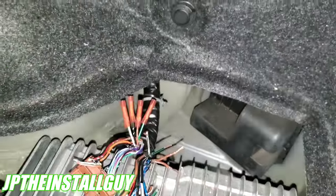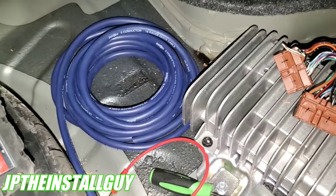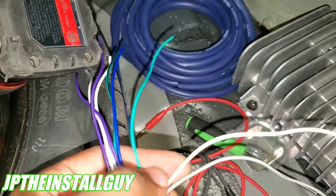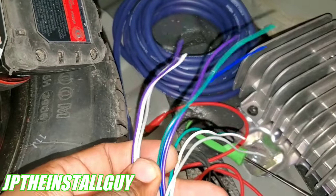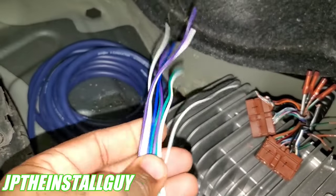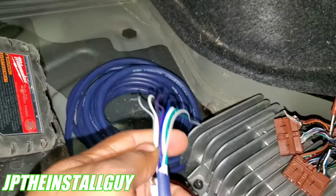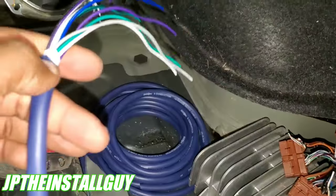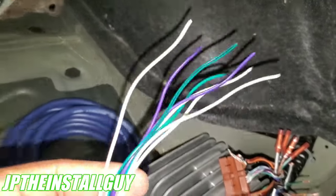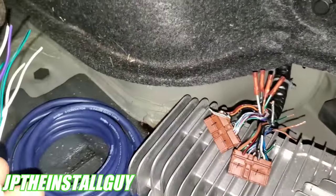Now that I've found my speakers, I need to get all these wires up to the front behind my factory radio. We'll use multi-conductor wire, also called nine-wire. Inside this blue jacket we have nine wires: eight speaker wires — two grays, two greens, two purples, and two whites — and a blue wire in the middle for remote turn-on. This is perfect for running to a four-channel amplifier, keeping everything nice and neat in one jacket. Since we're just bypassing the factory amp, I'm going to cut the blue wire because I don't need it. Then I connect my wire couplers and run this jacket up to the front.